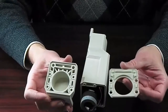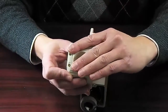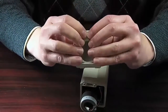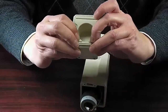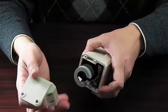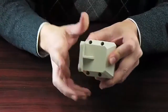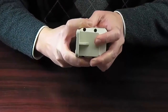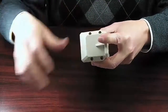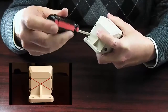Place the gasket back onto the cap with the large bumps of the gasket attached to the bottom of the cap. Make sure the gasket is aligned with the edges of the cap by pressing down around the edges. Now you can replace the cap and reattach the screws through the cap and onto the casing. Again, make sure you tighten the screws in the criss-cross pattern in order to avoid warping.